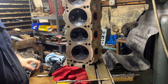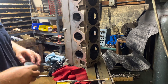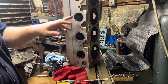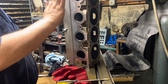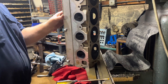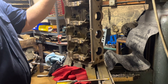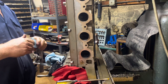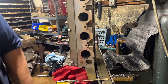All in all, they look pretty good to me. I wouldn't have done anything any different on these ports. I would say that's probably going to be right at or a little over 400 CFM on a flow bench if you were to flow those. Most of the cammer heads, once you put the intake up on it on the flow bench, it goes way over 400 CFM. Yeah, they don't look too bad. So we'll go ahead and clean these up, get them on the engine, check our piston-to-valve clearance and all that stuff, and we'll go from there.